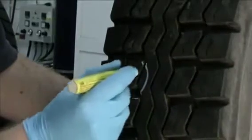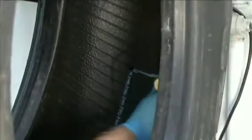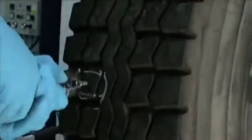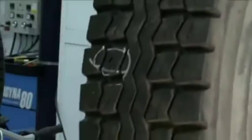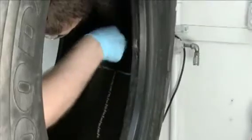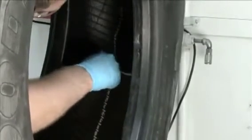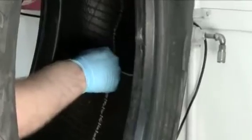During the inspection, locate and mark the damage on the outside and then the inside of the tire with a tire crayon. Remove the penetrating object from the tire if present. Note the angle at which the object penetrated the tire. Now continue the inspection and probe for ply separation. If separation is found, the tire should be scrapped or sent to a full service repair facility.